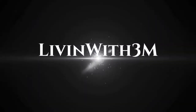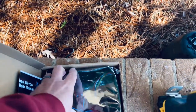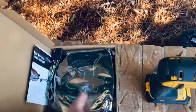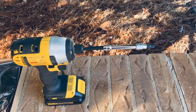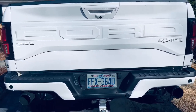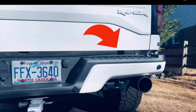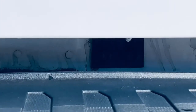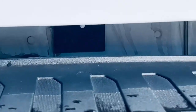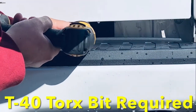We're going to install the third brake light, or tailgate light — the one under the tailgate, not the cab light. You're going to need an extension piece on a lot of these newer trucks. Coming around to the back of the tailgate, look up under there where you're going to mount this strip. You'll notice that black part — that's just an added piece on some of the newer trucks and we're going to have to remove it so the strip will go all the way across without hitting it. That's the reason for the extension.